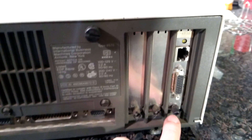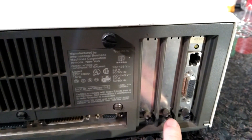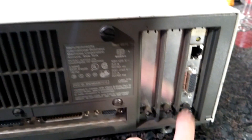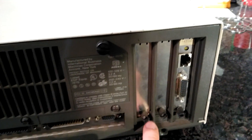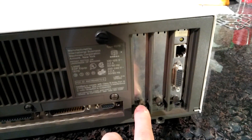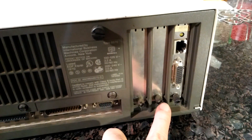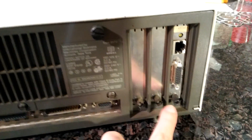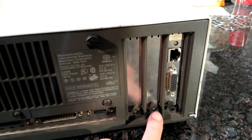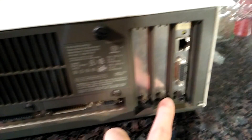When we go to the right, we have three expansion slots. These are what we call MCA, or Micro-Channel Architecture. This is another proprietary expansion slot that IBM wanted to introduce. However, unlike the previous formats, this one never caught on and we don't use it anymore. It's very ancient and it's very hard to find cards — especially sound cards — for these slots unfortunately. Back in the day, it was ISA that was competing against this.